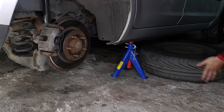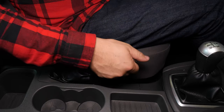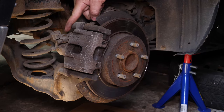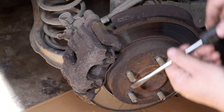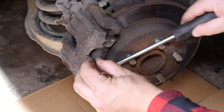Don't forget to slide them under the vehicle. Before starting, loosen the handbrake, otherwise you will not be able to complete the operation. Using a flathead screwdriver, lift the holding springs on the pad, then take it out. Make sure you keep a finger on the spring during the operation to avoid it jumping out.